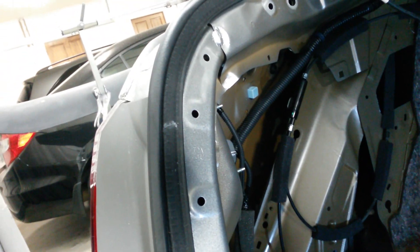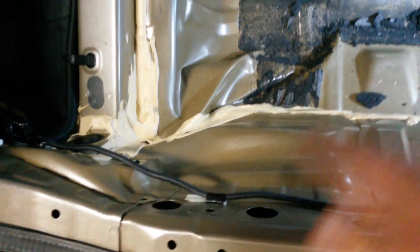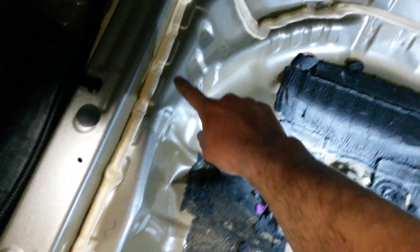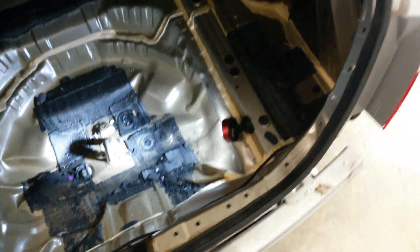I probably won't worry about that until I get all of this pushed out, get the trunk lid stretched and everything I need to do. Tap that in, then I'll measure the trunk opening and make sure I got everything right — that way I can leave it wherever I need to put it, just to get the trunk to seal and everything to line up. That's the main thing, is making it seal again. We're going to have to cut the outer rear body panel out first, then come in and cut all the spot welds along that seam all the way around, pull that piece out, put it in first and build it from the inside out. That's the game plan.